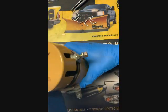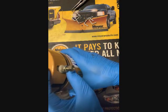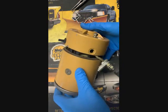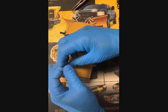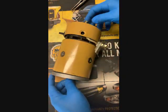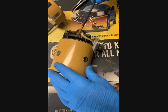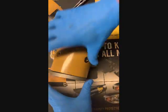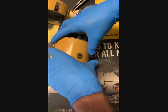And then it's just a matter of putting your lugs in — and see, they just slide right back in. This is a brand new motor so you won't be this lucky normally. Once you have it all together, hold it tightly. These come with square nuts when new — I always keep a couple laying around just for this reason. You wanna keep this all together and rotate until the bolt falls in place.